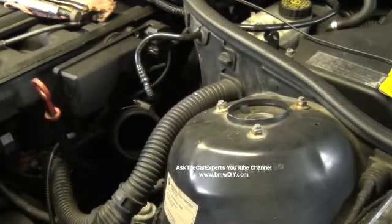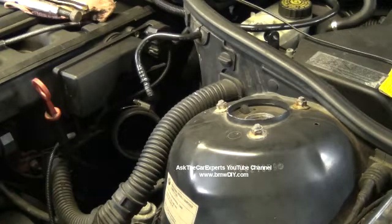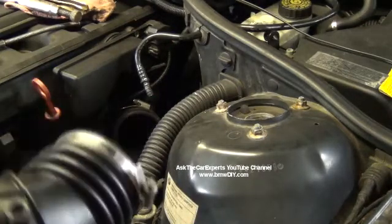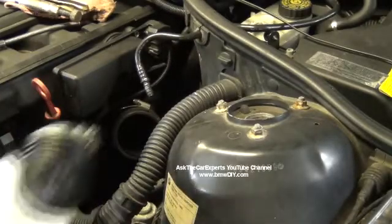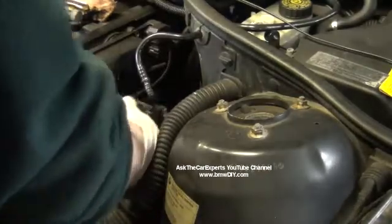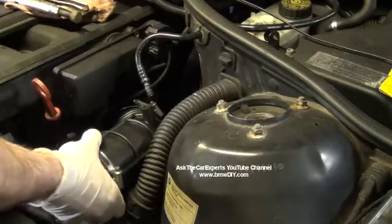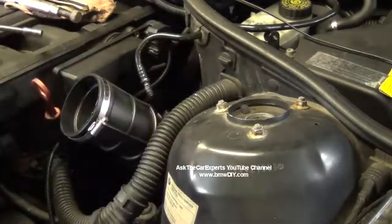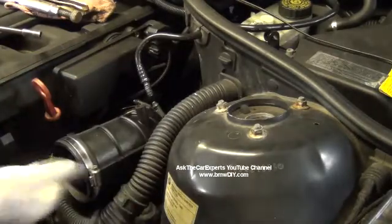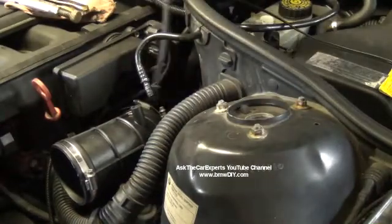Here's the new part. Swap the clamp over — it's amazing the difference in suppleness between the old one and the new one. Make sure your clamps are facing in a direction that gives you easy access to tighten them. You can put a little white lithium on this if you want. Push it into place — it slides right over. Turn it so it aligns with the air filter box, eyeballing it so it's nice and straight for an easy fit.